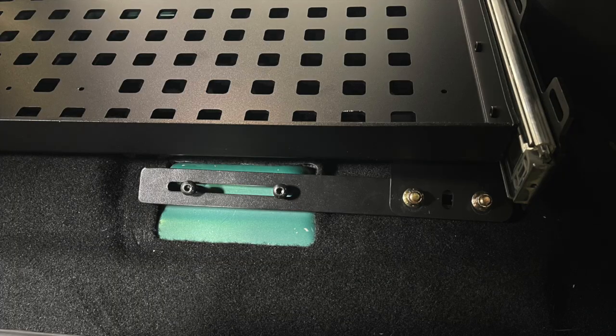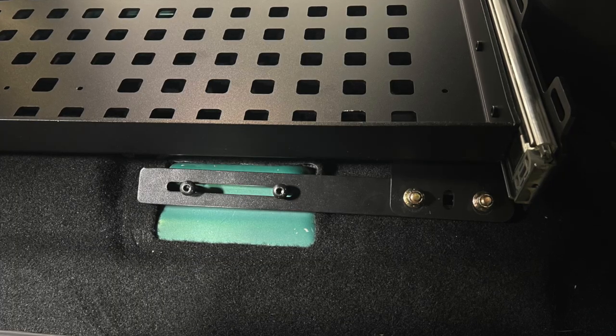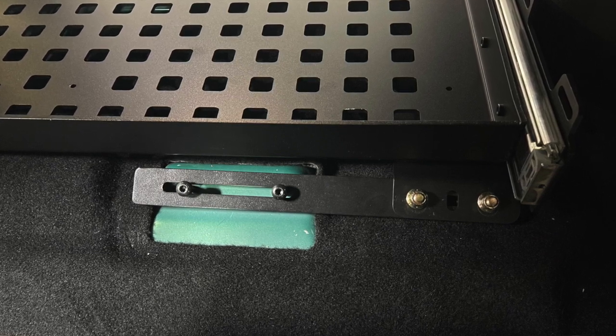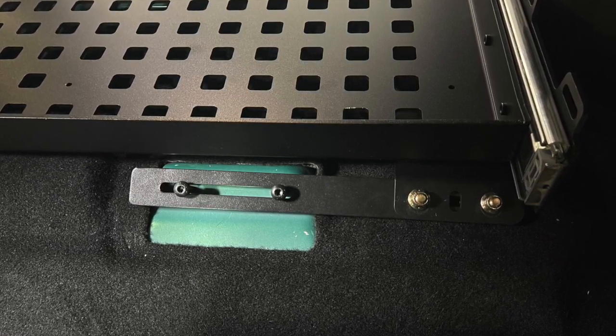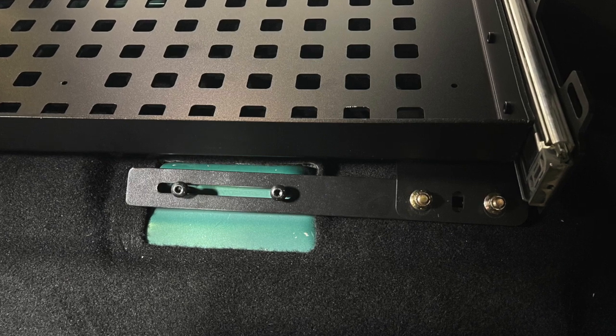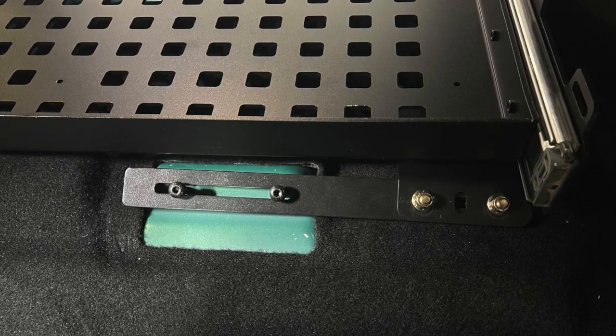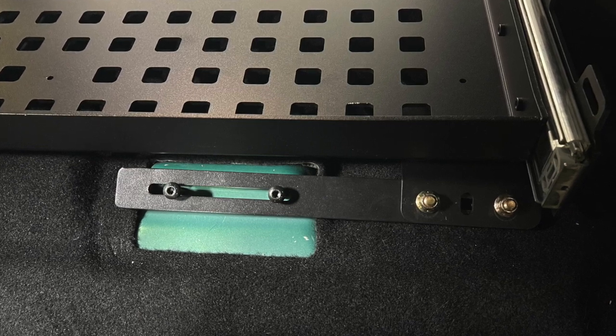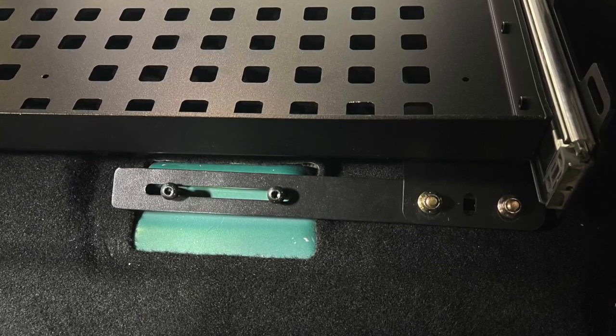Now with the tray fully slid outward, you will have access to the standoff nut closest to the tailgate. Secure both left and right. Let's return our attention to the Torx head bolts in the forward stabilizer brackets. Go ahead and secure the 2 Torx head bolts. If you find it necessary to readjust the forward stabilizer bracket, loosen the 3/8" hardware, reposition the bracket to a desirable location, and resecure.